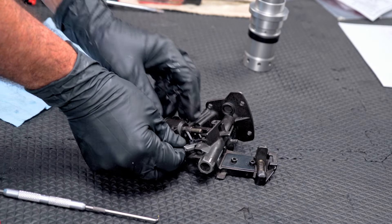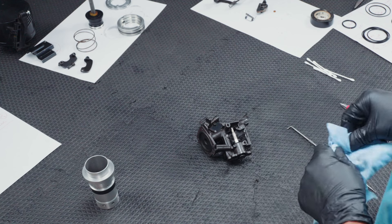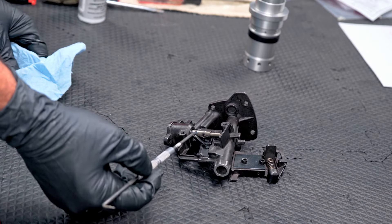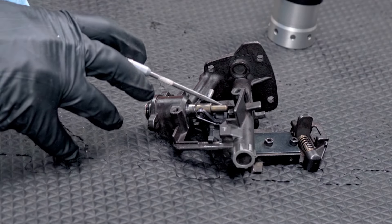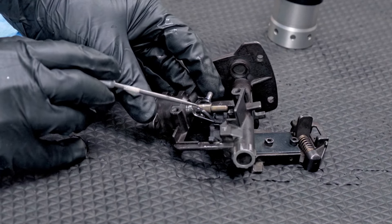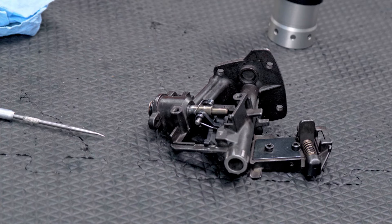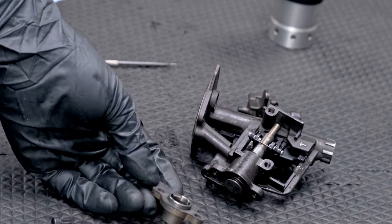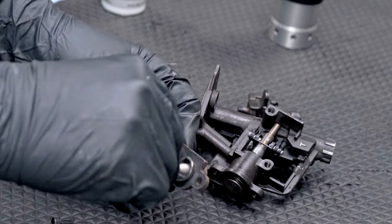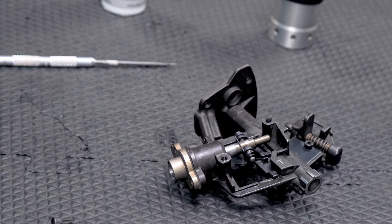Let's put our piece back before we push our plunger all the way up. I went ahead and pre-lubed that with some grease on the contact surfaces. Now we can put our spring back. Remember, if you've got a groove in here because of spring wear, go ahead and flip that around the other way and you'll have a fresh piece of metal. The little fingers of the spring need to go down in these little grooves right here, and the keeper is going to go on the bottom. Go ahead and push the pin down, and then the kit does come with a new keeper — it just slides over the end into a groove. Let's put our end piece on, taking a look at that gasket to make sure it's in good shape. I'll put a little bit of grease on the inside so that O-ring is going to be okay, then push that on. This one gets those short screws.